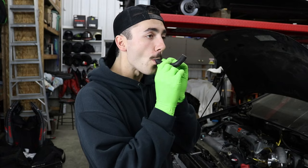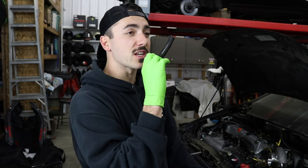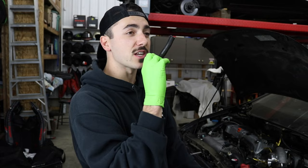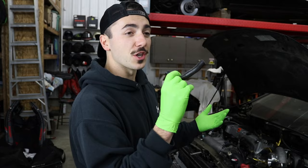So what does an engine do at idle? It's basically a big vacuum — it's sucking air in like crazy to get internal combustion in the cylinders. A brake system check valve goes directly to the intake manifold, which is under vacuum. So you need the intake manifold to be able to suck air through this line, which means the check valve needs to allow the booster to be pulled under vacuum. If it's flipped the wrong way, the booster will never go under vacuum — all that'll happen is when the engine goes under boost it'll push air into the booster, which can blow out seals.